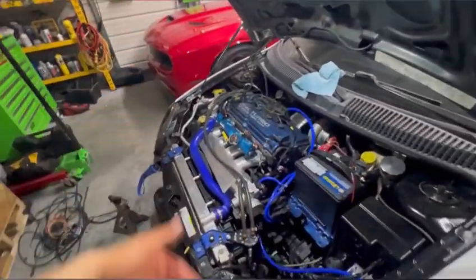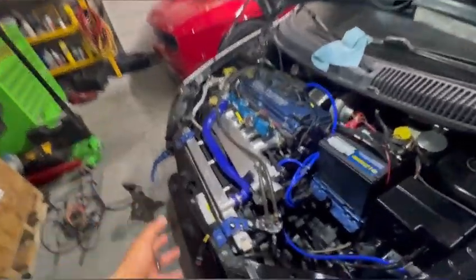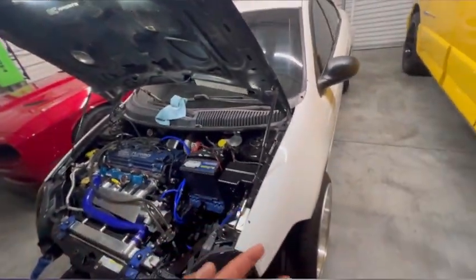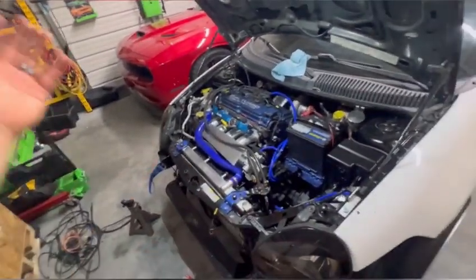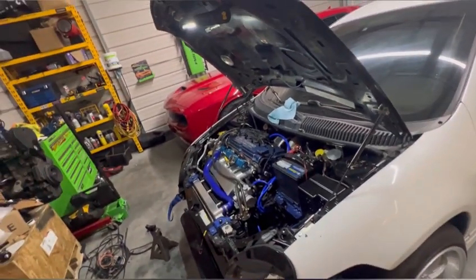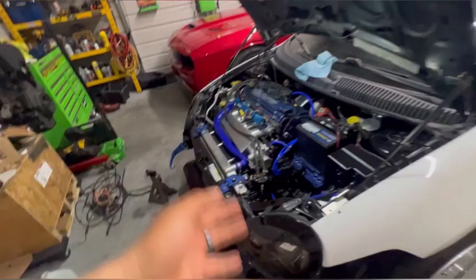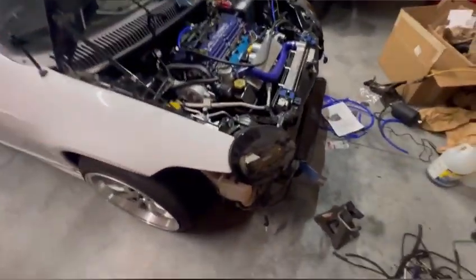These are HPS hoses — pretty good. For now we're going to put distilled water in the system, because if I decide to drain it, I won't waste antifreeze, which is more expensive. We have an oil cooler delete kit from MPX on the way. I need to plug up the old water lines first, otherwise it's going to spill water all over the floor.